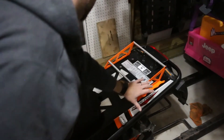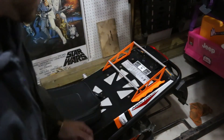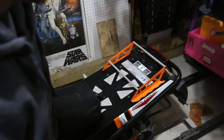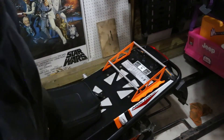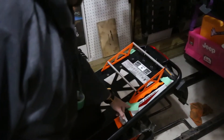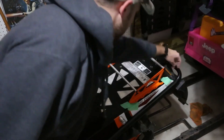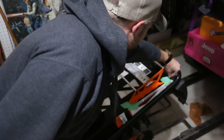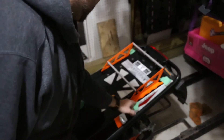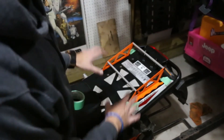Like I said, I'm going to put a piece of clear film over that to protect the tunnel so when you have a gas can riding around in there, it's not going to scratch up the top of your tunnel if you're particular about that kind of thing, which I am. I slapped a little bit of tape on there. Once I had everything lined up where I want it, I measured from the rear edge of this rivet forward two inches on both sides of the tunnel, and then used a strip of tape to mark the leading edge — that way I've got it centered.